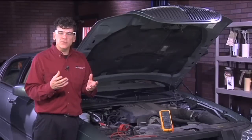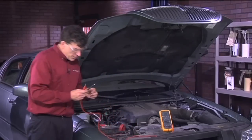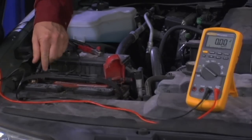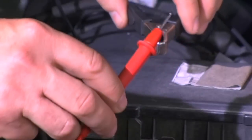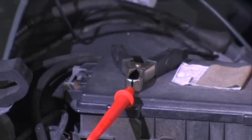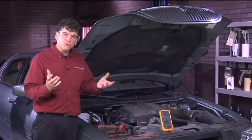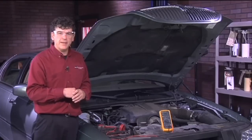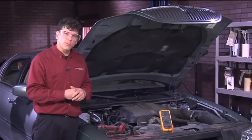To do the ground side, it's just as easy but we hook up our leads a little differently. This time we connect the negative lead of the digital volt ohm meter to the negative battery post. Then we take the positive lead and connect it to the jumper wire that's connected to the ground terminal at the fuel pump — that's this black wire. A note on jumper wires: prefer a straight wire rather than a spiral or coiled wire, as coiled wires often have a lot of resistance built into them.